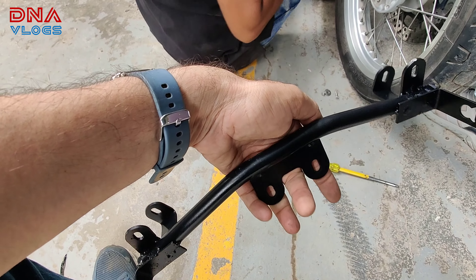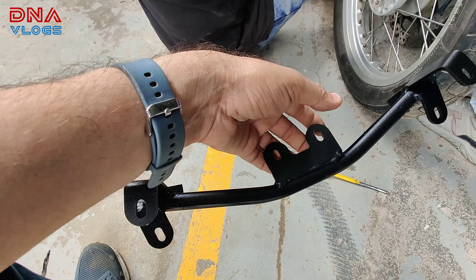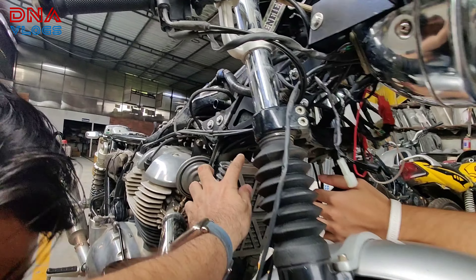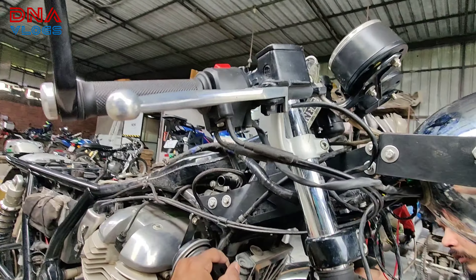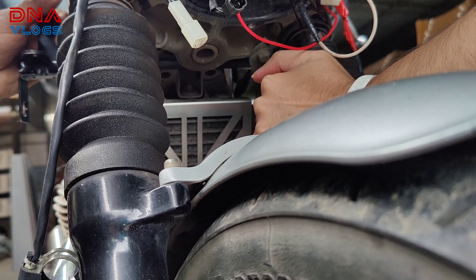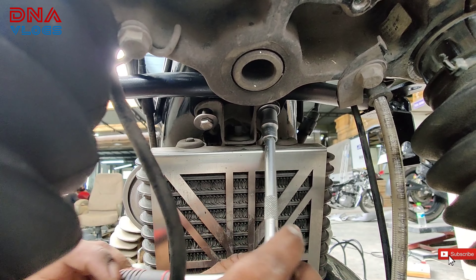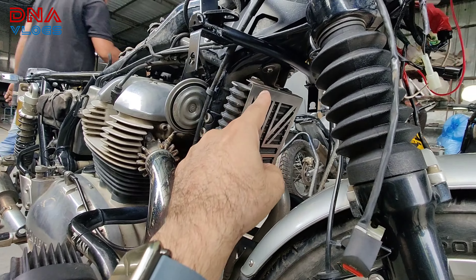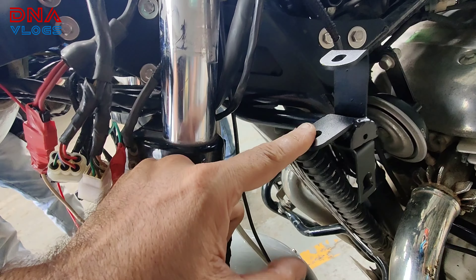Next, install the cross bracket above your oil cooler/radiator and below the fork T. Loosen the bracket bolts just above the radiator on both sides, and put this bracket in so it coincides with the original stock holes, then put in the bolts. Autolog will provide longer bolts to replace the two small original bolts from this location. On the right-hand side and left-hand side, this is where your indicators will come, and this will be used for mounting the fairing and fairing bracket.